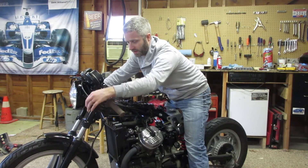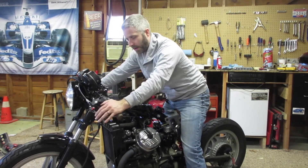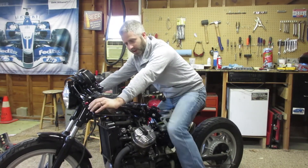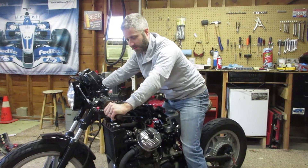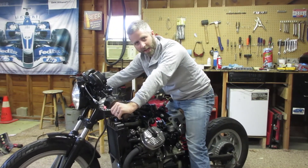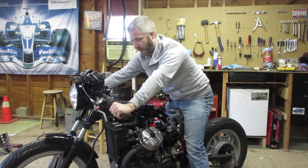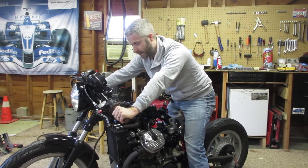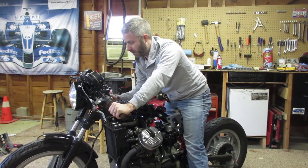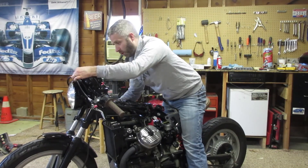Not so much on the clutch side. I've got the clutch adjusted right about to where it was previously, and even with the bike in gear and the clutch disengaged, I'm still noticing quite a bit of friction, which tells me that my cable might be just a little bit too long. And even though I shortened the cable by four inches, it's still really long.